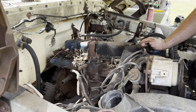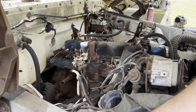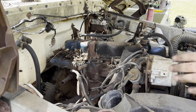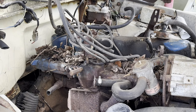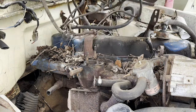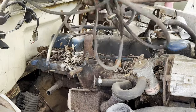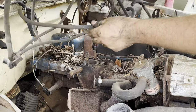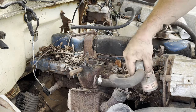Hang tight for a second. I'm gonna remove all of these and put new vacuum caps on them. All right, for the sake of simplicity, friends do not let friends drive around with all of this on a carbureted engine. So, done away with that.